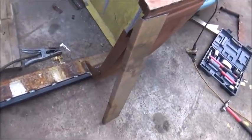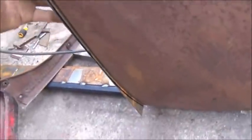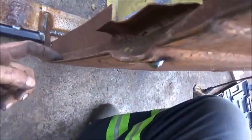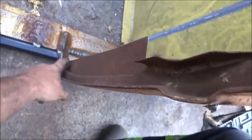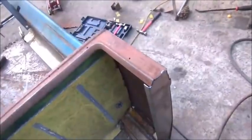Here's what we're doing to make our door jambs: I cut out a piece, put a 90-degree bend on it — that'll strengthen it up good. I actually marked it from the outside with a marker, so now we cut just a little bit inside the line of the exact shape of what you see here, and we should be able to fit it inside. That'll give us a good door jamb. It's at least 16-gauge, might be 14. We'll bend this down, weld it a little more, and connect it up to our piece. Should work out really well.